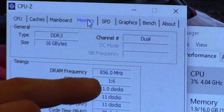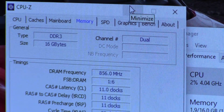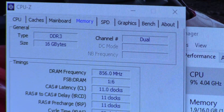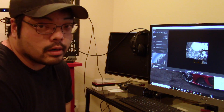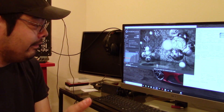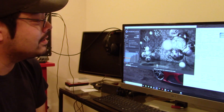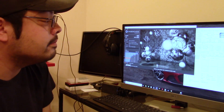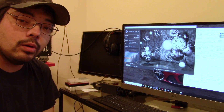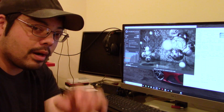If it crashes, the first thing I would adjust would be your RAM speed — slow that back down. But I have overclockable RAM, it's rated for it. So the next thing to do is see if it's stable in Cinebench. Don't forget the last score was 544 at 3.952 GHz. We are now at 4.066 GHz. Cinebench run is done at 4.04 GHz — we are at 559 CB score. At 559 Cinebench score we still have some room to go. In terms of max temperature: 57 degrees Celsius. So taking it from 3.2 to 4.06 GHz has only increased our max temperature by 4 degrees Celsius.